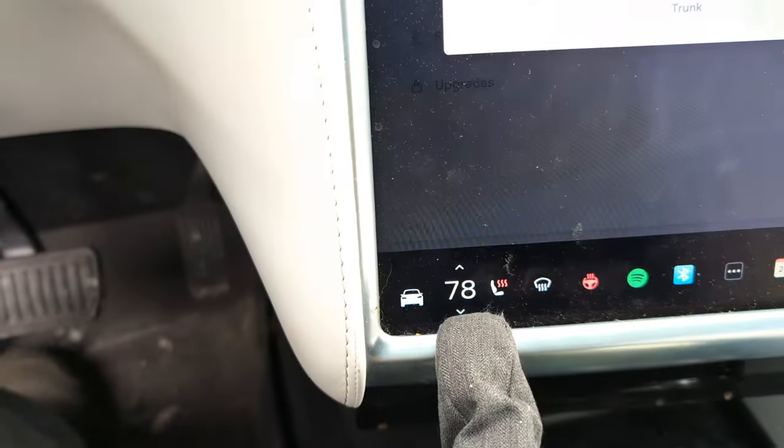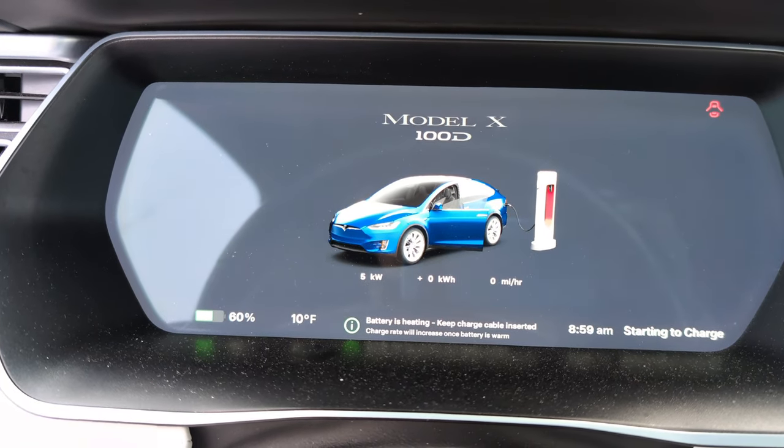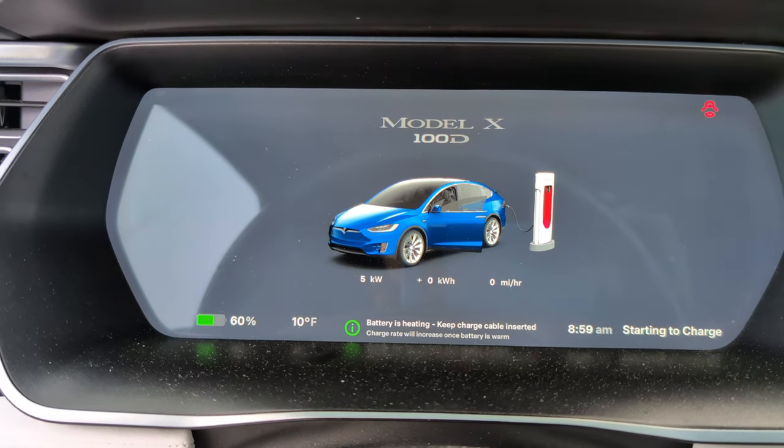I am now going to turn on the climate heat — let's get all the heaters going here. This is kind of a problem for generalized supercharger use because it just slows everything down. If you play this out with a lot of people doing this, the people that come to charge and are plugged in — now it's going to take forever. Now we're up to eight kilowatts, and still not getting any charge into the battery. Eight kilowatts just for heating purposes — that's some high-powered heating equipment. Fill up a supercharger station with really cold batteries and everybody has to wait for them to warm up and then wait for them to charge — that could be like 45 minutes.